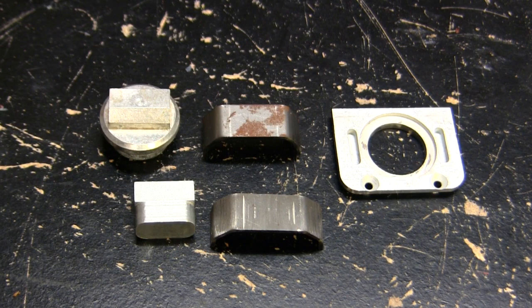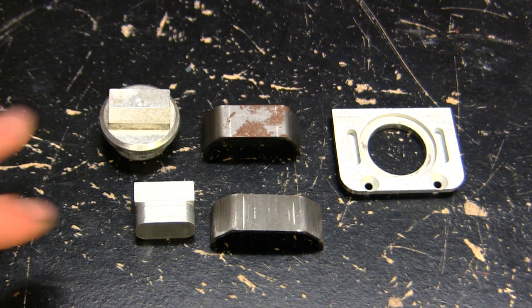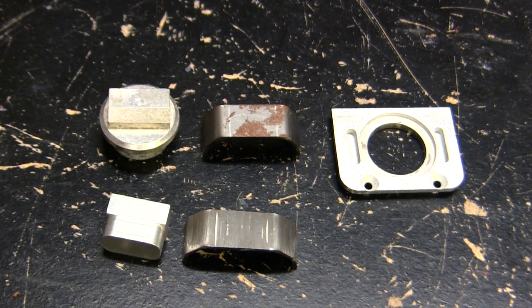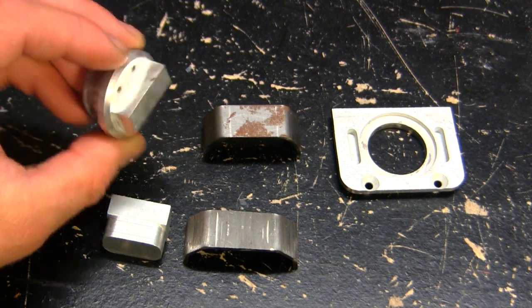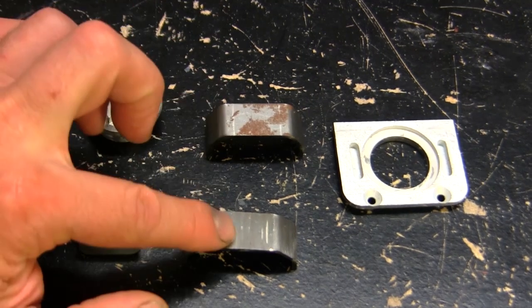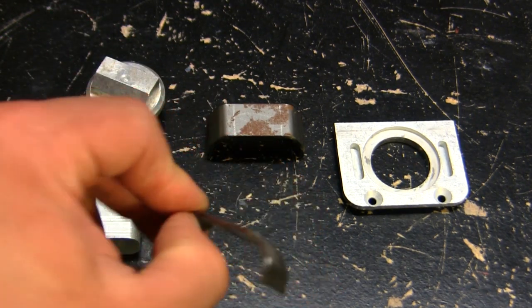Like what we've seen in the last couple of videos, the top front portion of the King Tiger's armored deck is starting to fill in with its detailing. The remainder of the details consists of a driver periscope located in the front, and two units for the radio operator. All the components you see on the table are stocked with the Armortech kit. The parts consist of components either fabricated out of CNC aluminum — like this periscope block and mounting plate — or comprised of parts made from laser cut and bent steel, like these two brush guards.